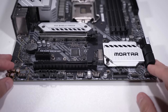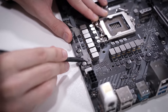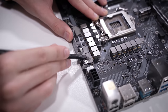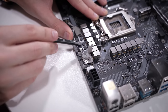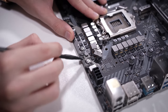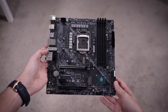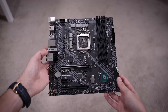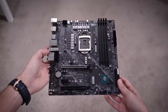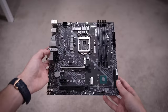Nothing else was to blame. I will say these thermal pads are like super chalky — I can't even pull these up with my hand. I have to scrape this stuff off because it's just breaking like clay. Probably shouldn't be like that. Here is the board completely stripped down with all of the heat shields removed. The physical inspection checks out — I don't see anything super alarming here. At this point we would just have to start probing.